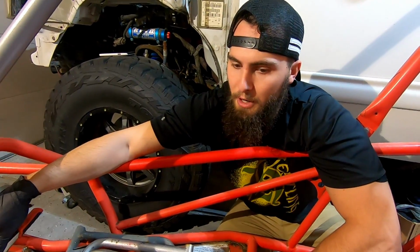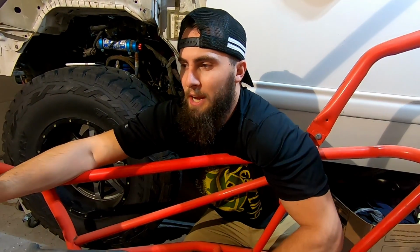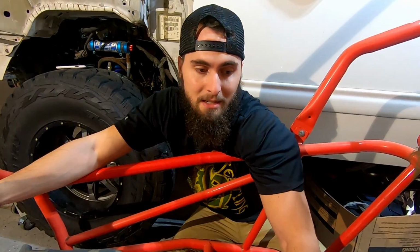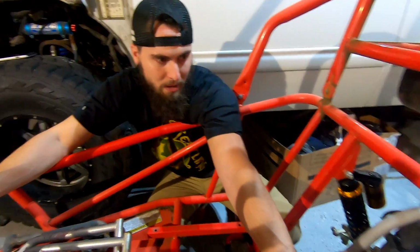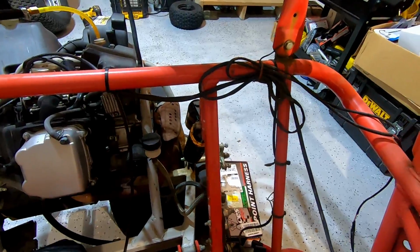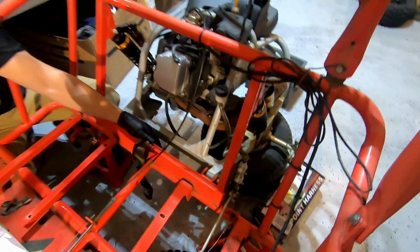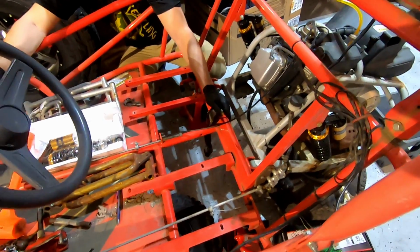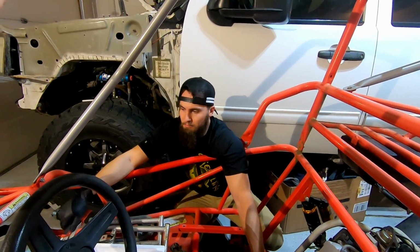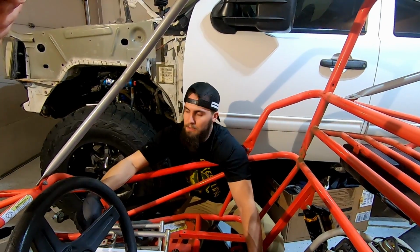You can also get over the brake over there, but you will be doing like a 2-foot operation. So one for gas, one for brake. I thought about trying to move the brake to where the gas is, but as you can see over there where the master cylinder is, where it's mounted, I wouldn't be able to run that through here. And I'd basically be drilling a hole, making my own. It just wouldn't work the greatest. So we're gonna go ahead and leave the brake over there because it's still easy to get at. I kind of mocked it up roughly sitting in the seat. It'll do all right.